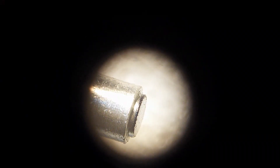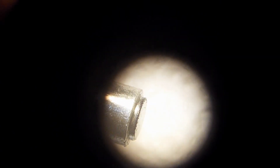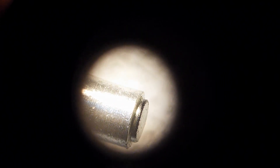This is viewing through my microscope lens — kind of hard to see, but you can clearly see that there are little steel particles on the tip of the magnet. I'm going to wipe it off with a piece of tissue and then we can look at it there. The lighting in here is kind of a warm white, so that's why everything looks red. This is the tissue that I wiped the metal off of the end of the dipstick with. We'll look at it under the microscope and see what we can see.